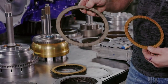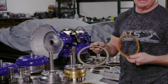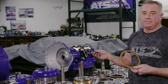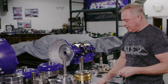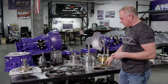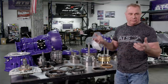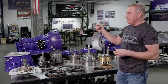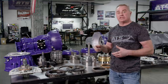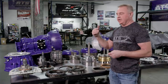Fourth gear is the big failure on the 68 — the industry just fights keeping these things alive. Again, I'm not putting the 68 down; if you want a reliable transmission for normal work, the 68 is certainly less money. But with our bell housing, electronics, and the fact that you don't need extreme upgrades on the Allison, the cost gap has shifted to where you're only a couple thousand dollars apart between the Allison upgrade and the 68 upgrade.